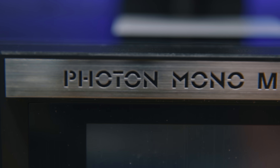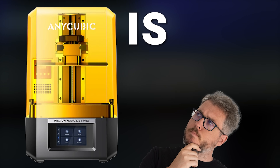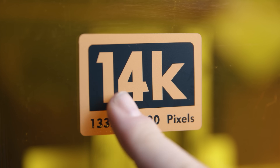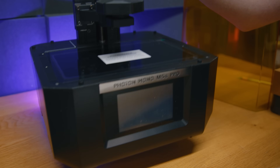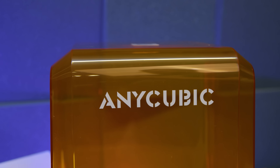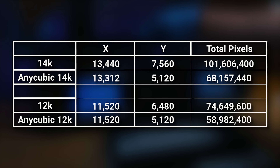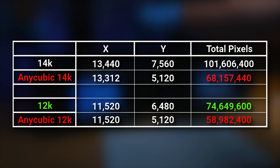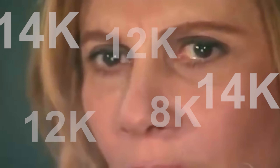But is it perfect? I'm Ross and this is Fohammer Videos. First things first: this so-called 14k printer is not 14k. I'm going to make a separate video on why, but the short version is that the 'k' metric is a terrible way to compare printers. This is not a 14k resolution printer — whenever you hear 14k, think bull. It's only about two-thirds of the pixel count you'd expect from a true 14k resolution, and the pixel count is about 6 million pixels less than what a true 12k resolution would have.